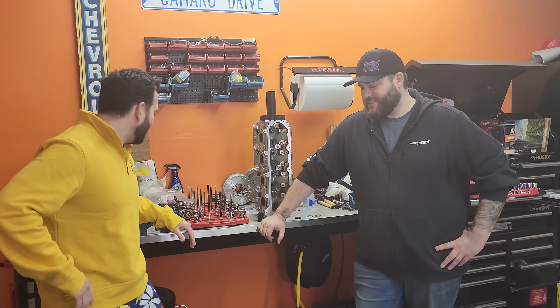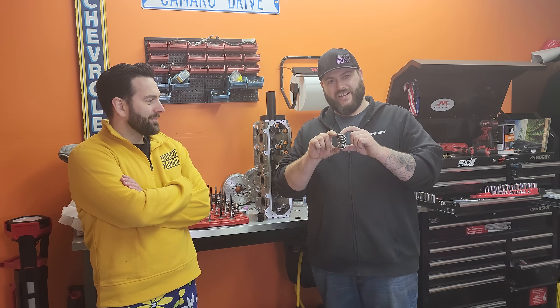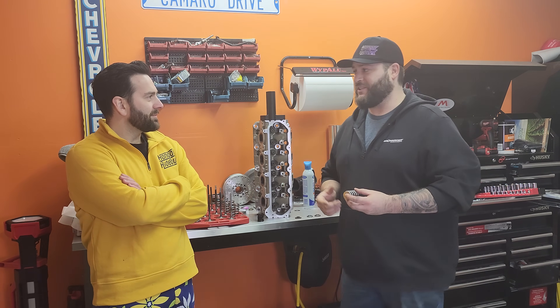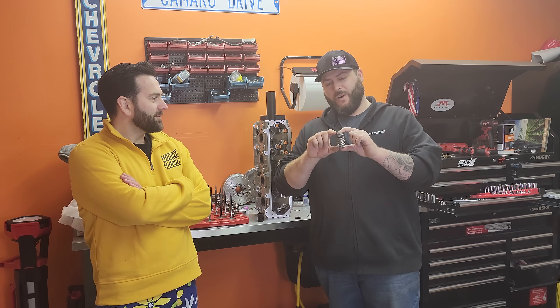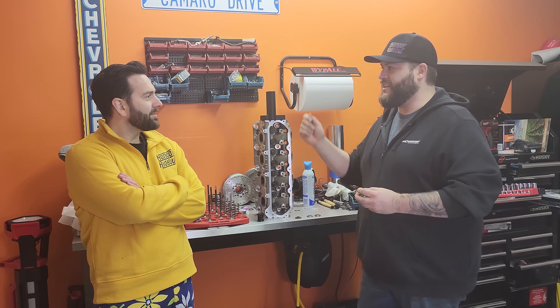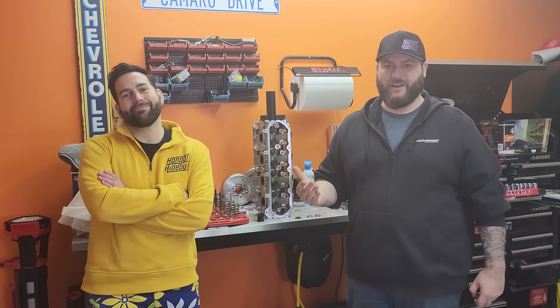It's important because of harmonics and frequencies. As the valve opens, the spring gets compressed. Cars have shock absorbers to get rid of harmonics, but valve springs don't have shock absorbers. So how do we cancel those harmonics? We run it close to coil bind — when the valve opens, these coils actually tap each other and cancel harmonics. Think of it like a tuning fork: you hit it on the table, it makes sound; put your finger on it, it stops. You're essentially canceling harmonics and frequency.